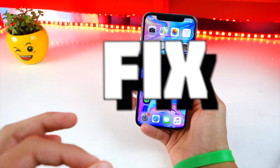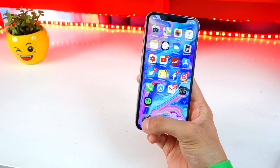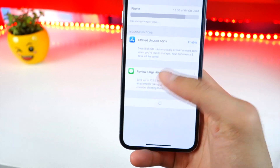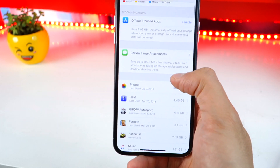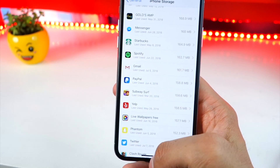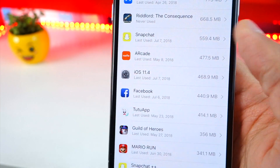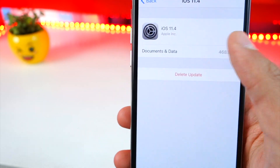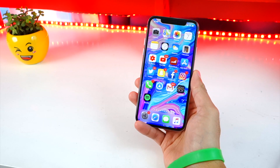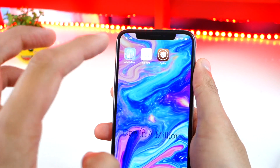But I have found a fix for you guys and myself, and this actually does work. If you're having this issue, first open up your Settings application. Go to General and look for iPhone Storage. Here you'll find what's taking up space on your device. Scroll down and look for any downloaded software. I had iOS 11.4 downloaded — it looked like this. So I went in and deleted it because it helped fix the problem. Just tap on it, hit Delete. Make sure you don't have any other software downloaded on your device.